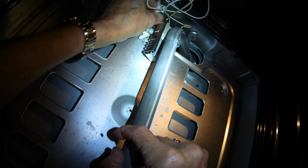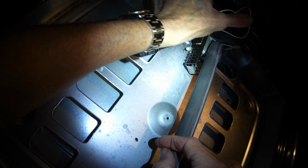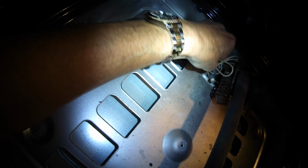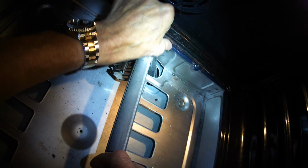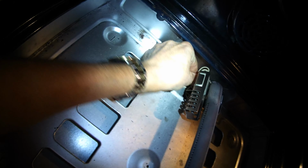And push this burner tube now down onto a little gas jet there at the bottom. Make sure it's securely on that jet so the gas can flow right into the tube. And I'm going to push these extra wires down into the cavity because we don't want these to heat up during the bake cycle. We want to protect them, so we're going to push them down into that cavity, get them out of the way.